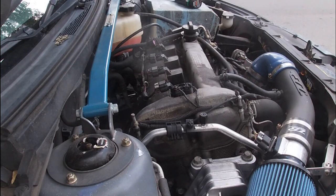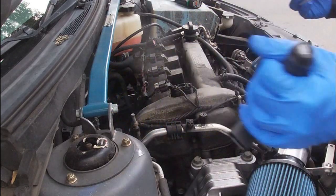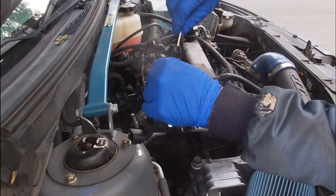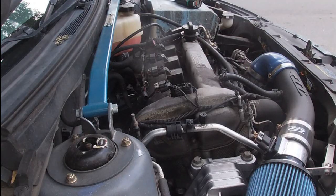I'm going to dielectric grease each coil pack so they're all ready to go. I know I'm off camera but I showed you how to do one. We'll show the second one again — same thing, a splotch of dielectric, and again you take the Q-tip and smear it around nice. This way they'll all be set up and ready to pop in, so I'm just going to go down the line.